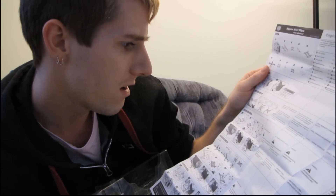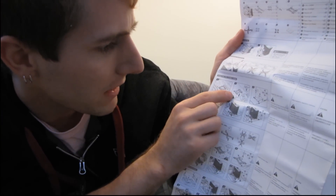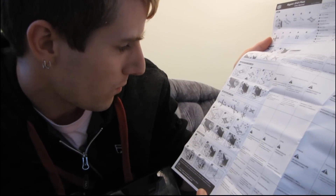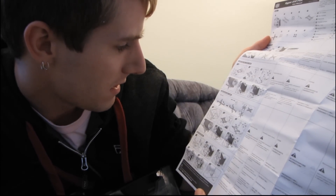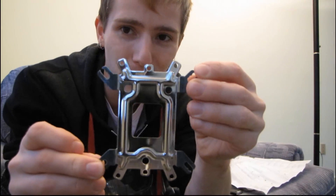Looking at the English instructions — I was right the first time. It looks like for LGA 1156 the back plate actually lifts up off the back, whereas for AMD we're actually using the back plate on the other way — we flip it around. So for AMD you put it on this way, and for Intel you put it on this way. We figured it out.